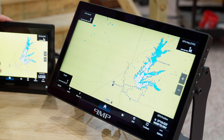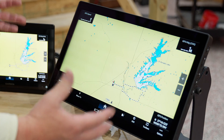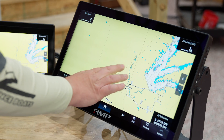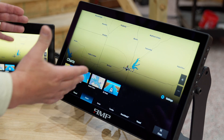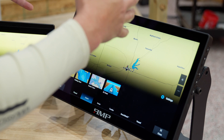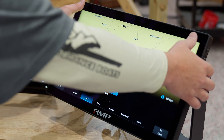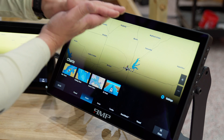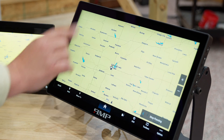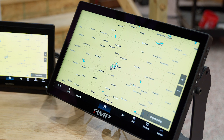Now we've got the 8612 hooked up to our Flex 19. As we can see, we do not have the thumb width on the left and right hand side because there's no limitation — this comes over full screen. We still have all of our touch features: plus, minus, stop panning — we've got everything here. So the 8612 and 8616 connected to the Flex via USB and HDMI are going to have full screen and full touchscreen capabilities. The 8610 and 1243 are going to have that thumb width gap on the left and right hand side, still full top and bottom, still full touchscreen, just might be off just a smidge. The 16 would be the same thing — full screen, no gaps on the left and right hand side.